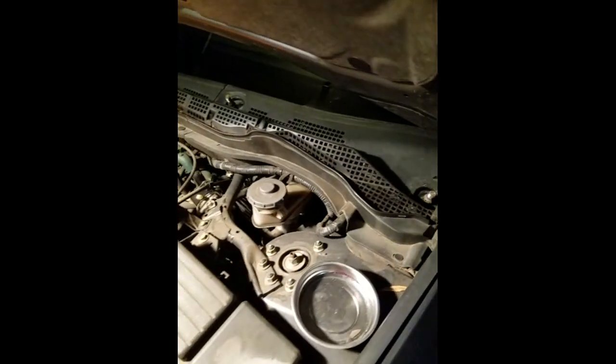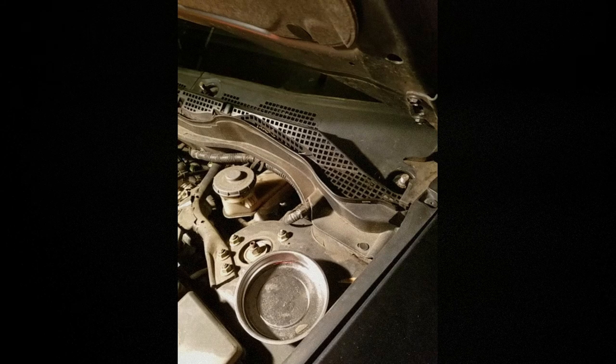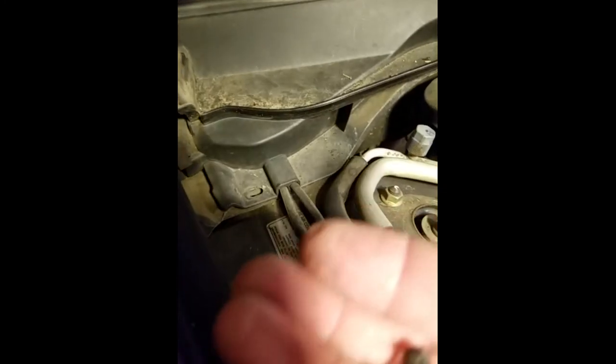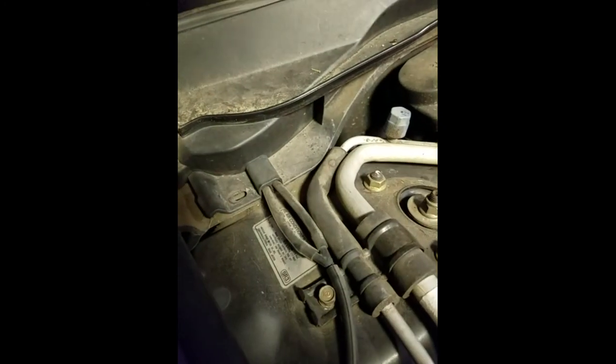Since this is a multiple-piece cowl, I've got my flathead pry tool. I don't really know where the clips are but I'll just walk it along, look for those little clips, and pop them off wherever I find one. I'll have to work it from this side as well. The pry tool is superior to a flathead because with a flathead you'll actually shear off the little stem. The pry tool reaches around the stem and pops the head up evenly — got her.